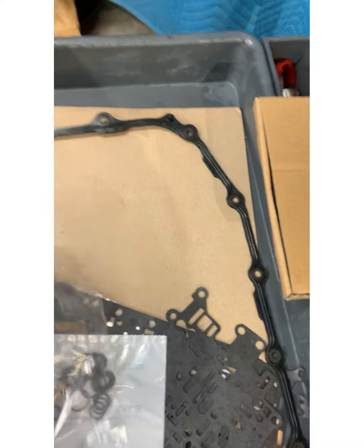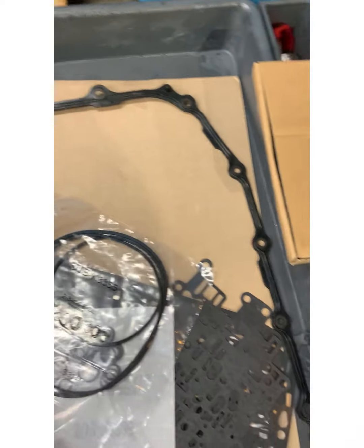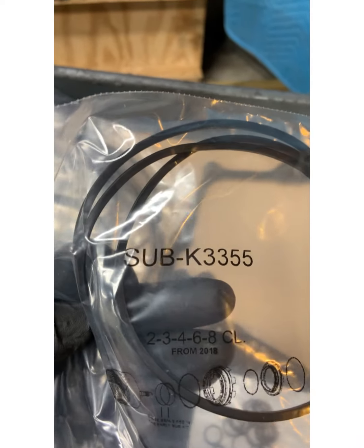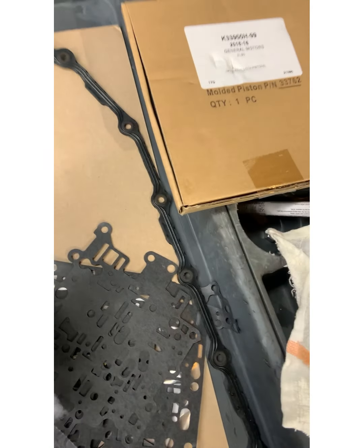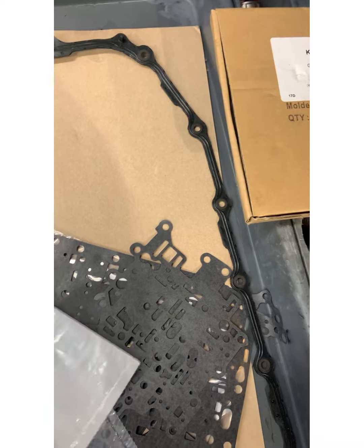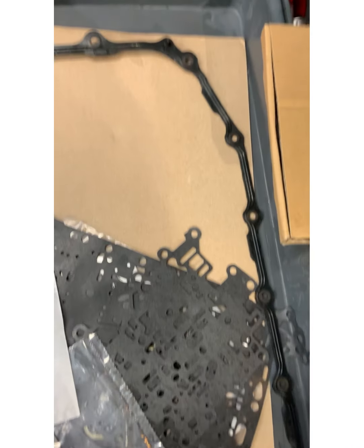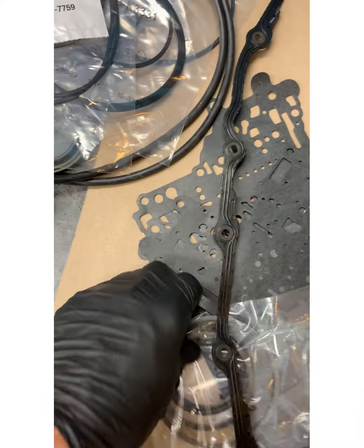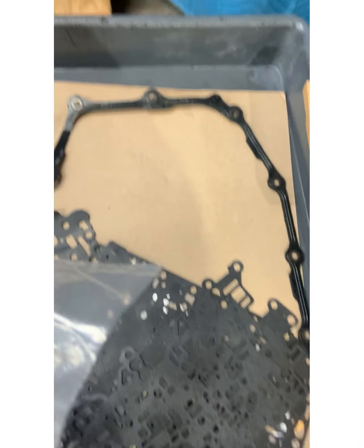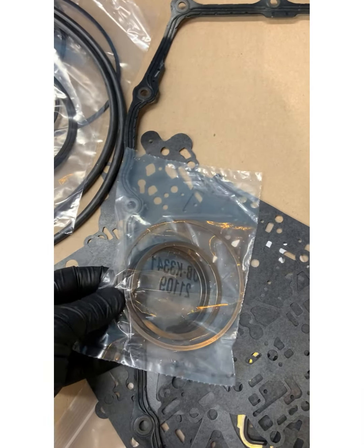And here for the one-three-five-seven, three-five-six-seven clutch — I like that they put these labeled and don't just put them all loose, because sometimes it gets confusing where they actually belong if you have to sort through each one for the two-three-four-five-six-eight clutch. Here are associated o-rings, and I suspect these are dealing with the valve body solenoid seals.